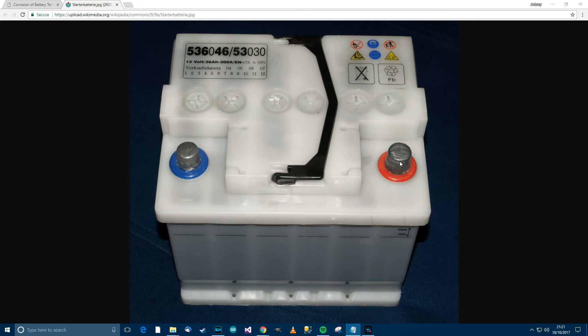And what it would make is a substance called lead sulfate. In my case, though, there was an additional problem. I've got brass or copper terminal connectors on top of these little pillars. So it's not lead sulfate on my connectors — because they're brass or copper, I've actually got sulfuric acid corroding those, and I've got a lot of copper sulfate on mine. But generally speaking, that's what it is and that's how it happens.